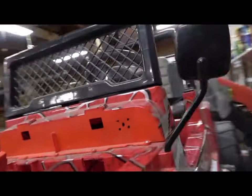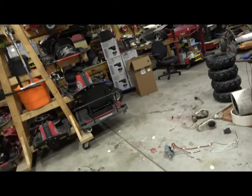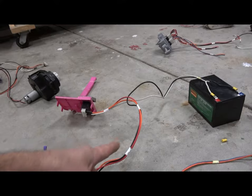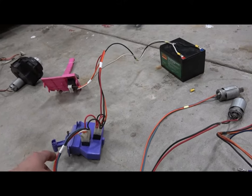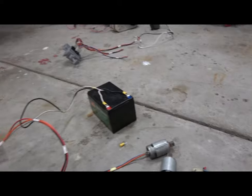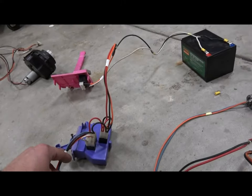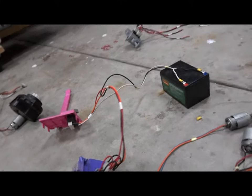Before you install everything, you need to decide what you're going to do. You've got your foot pedal coming into the shifter — are you going to keep low speed and low reverse? In low speed, it steps the power down by wiring the motors in series — it goes out one motor, back to the shifter, out the other motor and back. If one motor goes bad, the ride-on won't work except in high gear, which keeps both motors in parallel.